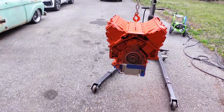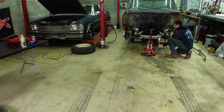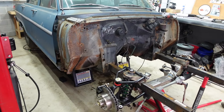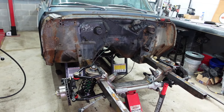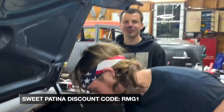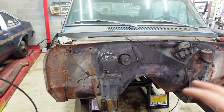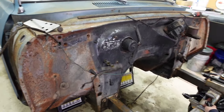Now we got the engine drying after a quick paint. We're going to test-fit the motor while Patrick disassembles the front end, because we want to paint the whole front of the car before putting the motor in for good — it's already starting to rust. We're using the Sweet Patina blackout paint we used on the trunk. We were deciding whether to make the firewall super smooth and show-car nice, but it's a patina car so it doesn't have to be.